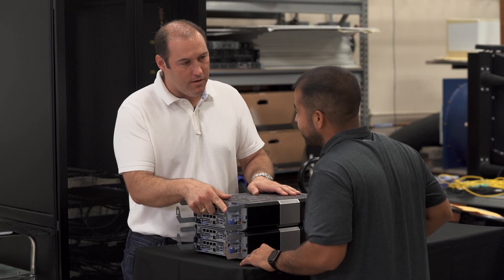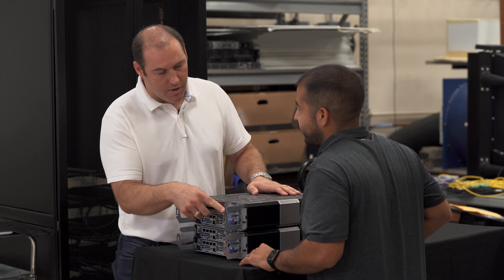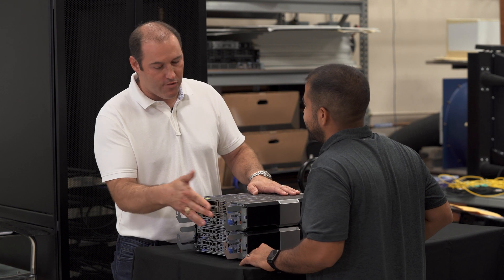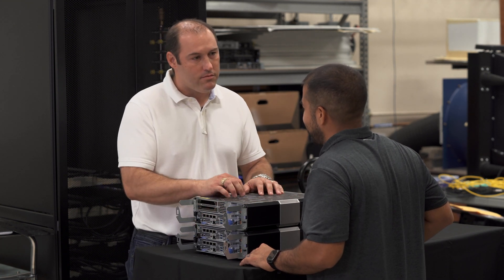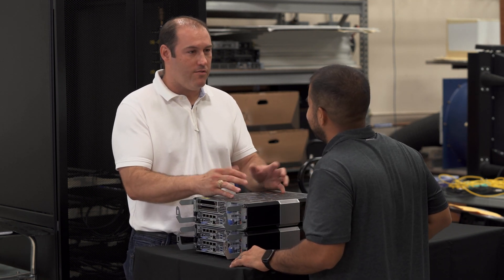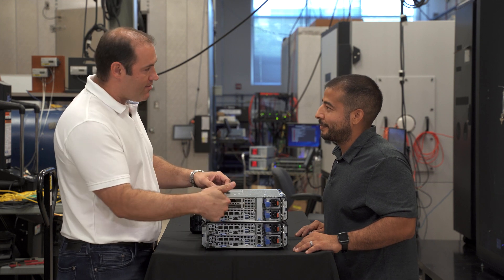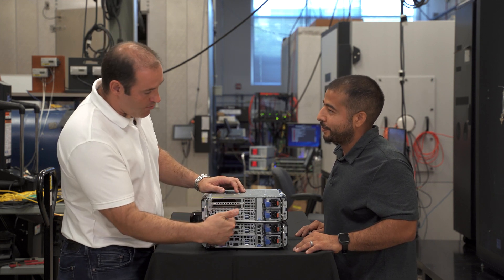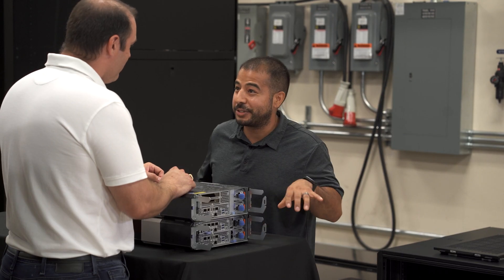This color coding is common with what we call cold aisle support. You can put this into a rack and cable it from the front — all the I/O and cabling will be on one side and you never have to access the back. So in a small edge environment, not a lot of space — push it all against the wall and you can still access all your ports, all your servers, the witness node. You can service the fans too; the fans come out with the server.